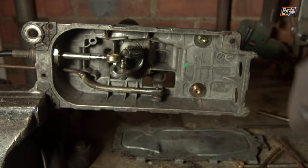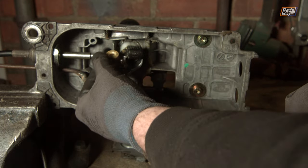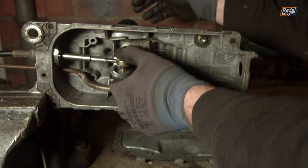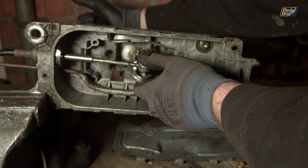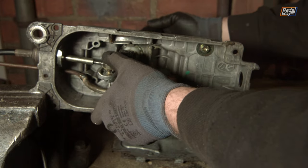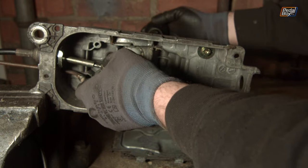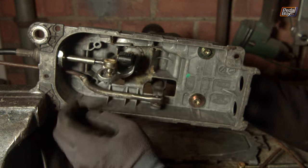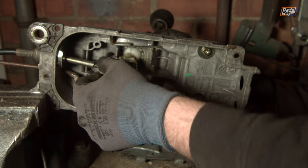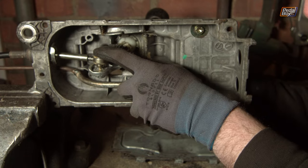I'm not going to put this all the way on because it's a nightmare to get off and I don't want to fracture this bearing. I had to pull out the little bushing to weld it so I didn't melt it, but even then it got a little bit warm on the first tack. You can see all the way in one direction, all the way out — it doesn't drop out of the sleeve and the movement works perfectly. But I've now just noticed that once it's clipped in, you might not actually be able to select fifth gear. We have fourth — but we might not have fifth, and that is going to be a problem.